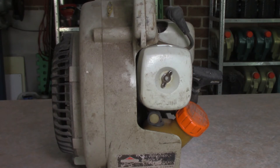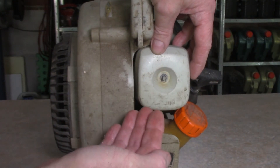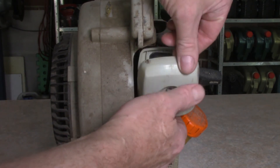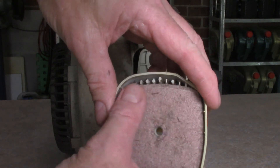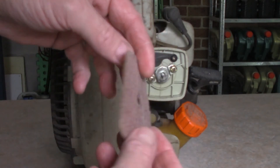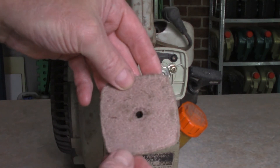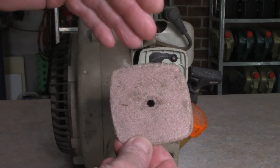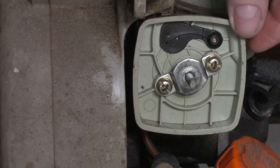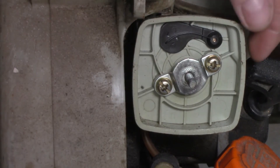One of the most important things that often gets forgotten is the air filter. This fella is vitally important for the running of the engine. Just keep in mind, what's this thing doing? It's going through dirt, it's going through leaves, etc. And the poor old air filter has to suck in clean air, in theory, to make the engine operate. So let's pull that off and have a look at it. It's actually not too bad — it's got a little bit of grot on there, but it's certainly not packed with dirt. It's actually not too bad; it should be a cleaner colour than that, but it's certainly not absolutely chockers as you might expect. What I'm going to do is run it without this filter, to cut out any air trappings or blockages as a result of the blocked filter. Another thing we need to observe is the choke — this simply is a flap that goes over the entrance to the carby, making the mixture richer or less air in this particular case. That seems to be operating okay.